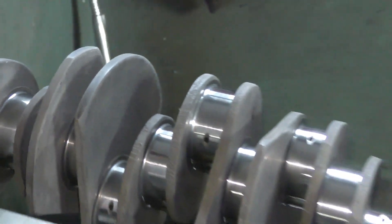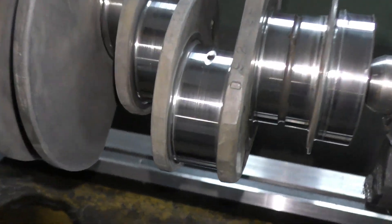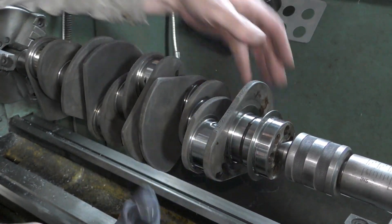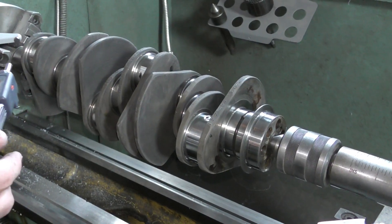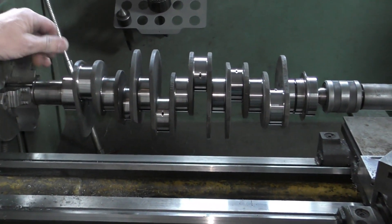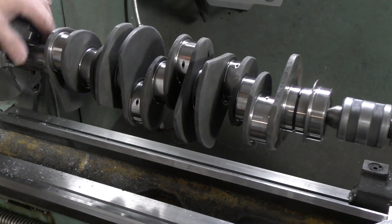Here's our finished product. I'm going to take my mic — still tight, still tight. A little bit loose on that one, still tight — not even close to the wear limit. The measurement reads 9.977 — not even close to the wear limit. That's it for a polish. Next step is into the parts washer to scrub it all clean — we want to make sure all of our oil passageways are clear and we don't want any debris from our polisher stuck in an oil galley. Once everything is cleaned we're ready to press our gears back onto the front.